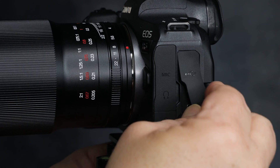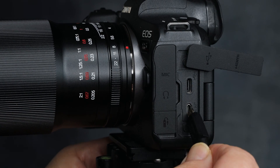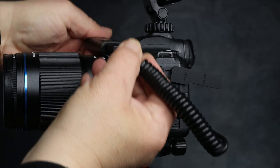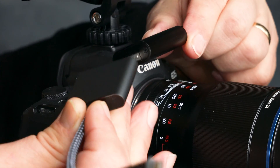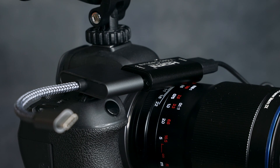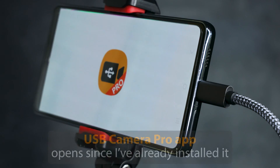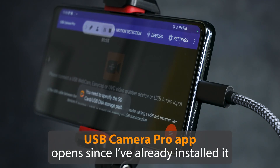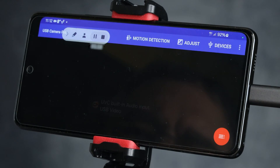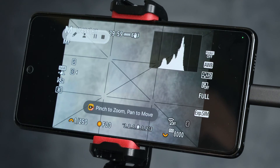For my camera, I'm going to be using my Canon EOS R6 mirrorless camera, and I've got the HDMI output connected to an HDMI capture card that then plugs into the USB-A 3.0 port on the OTG charging splitter adapter. The USB-C plug on the adapter then plugs into the port on the phone. Sometimes I also need to confirm the USB device, but you should then see the camera output on the phone.